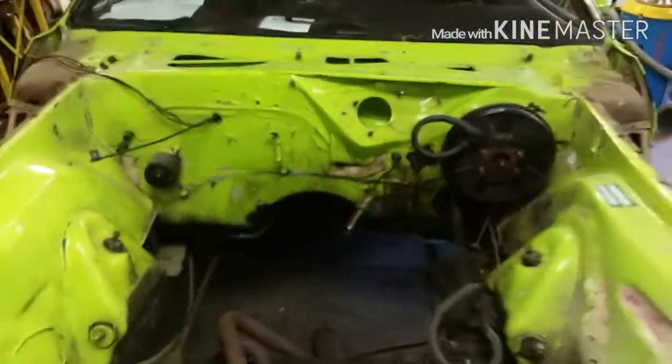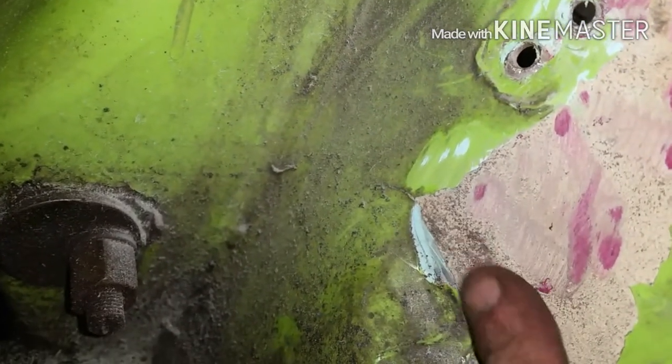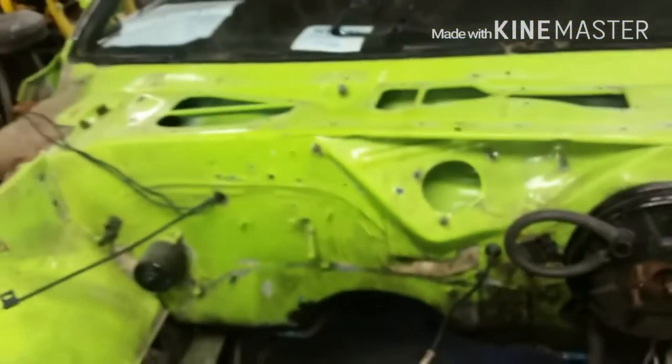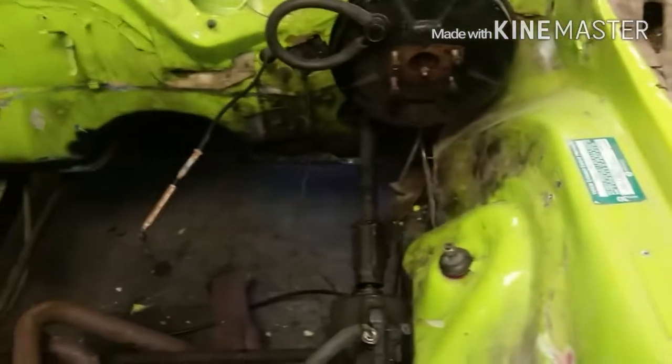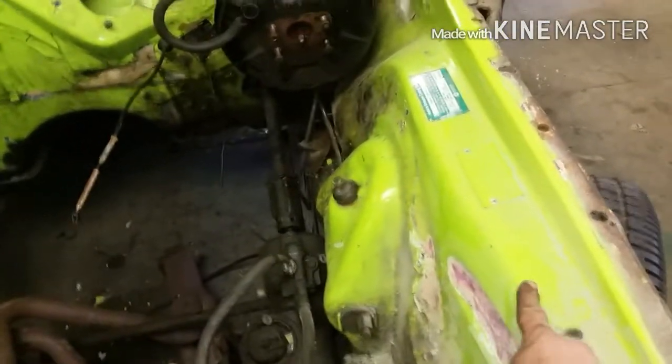She's showing her signs of age — not been well taken care of. But that stops now. We're going to do a good one for it. What I may have jumped to the conclusion on when I said this was all Bondo — I started digging. It seems like it's some kind of polyester filler that you would spray on. It's just like one layer, like someone coated the whole thing and sprayed it and then just didn't do that great of a job sanding it, because the paint's peeling off or it's flexing around. So this does have some real metal underneath it. It's a double layer, so it's the outer part that's rotten. Question is, can I separate them? Maybe one of you guys knows — because I was looking in the parts breakdown, there's an inner and an outer fender area. So I could save the inner.